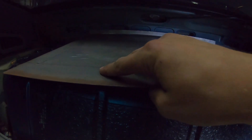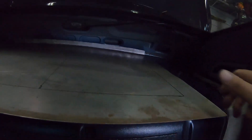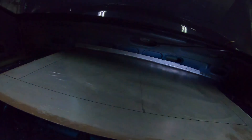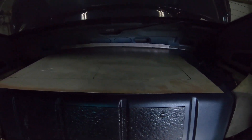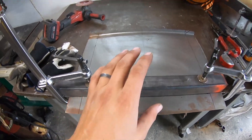I'm gonna leave that for now and get everything else bent up. That will allow us to screw at least three screws right in there which secures and seals the back - that was my biggest concern, being able to seal it. In the event there's a fire you want to keep the fire out of the car, so any through-hole fittings on firewalls obviously need to have grommets and things like that.